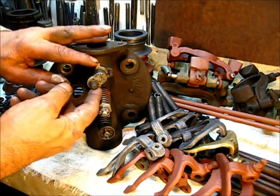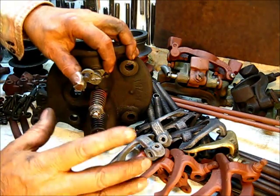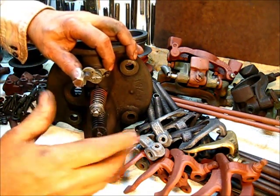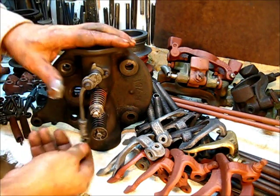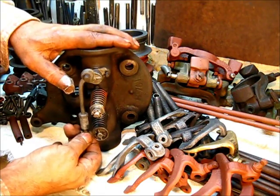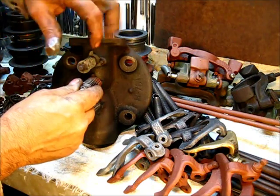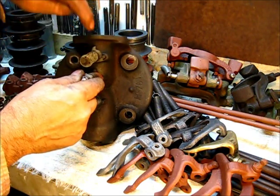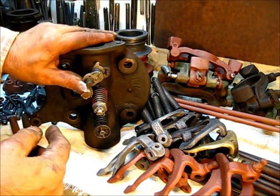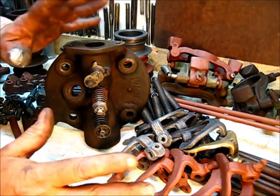The original was a pot-metal construction with a little ear at the bottom and one up here. We'll talk about how to set the adjustment when we assemble the baling wire engine. The way this works: when the weights on the governor go out, this mechanism goes up and down and closes the baffle inside. The original ones have a little protrusion cast on the outside in alignment with the baffle inside the housing, so you can always tell where the baffle is — when closed it'll be straight across, when open it'll be angled up.